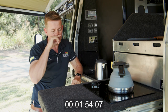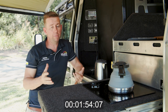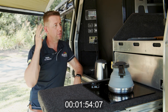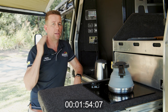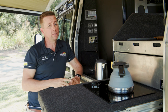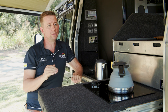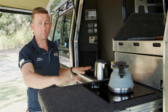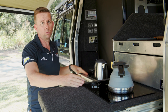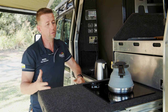We've just clicked off. On the stopwatch, that is 1 minute 54 seconds. So to boil exactly the same amount of water in the same conditions from the same inverter with the same battery, it has taken twice as long using Old Faithful. That's dropped it down to 77%. They both draw similar current but for twice as long. So if you scale that to a litre of water, that's two minutes difference; two litres of water, four minutes difference — and it's exponential from there.